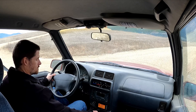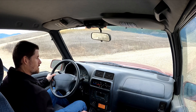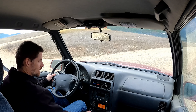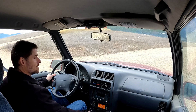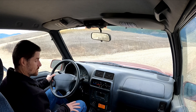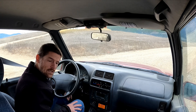One thing you'll find with this HyPer 9 system is that on a downhill, regen will never completely stop you — it will just bring you to a very very low speed, because it seems to be proportional to speed at low speeds. This adjustable knob is what I normally use because there are so many different grades around here and I need the ability to adjust the rate at which I'm slowing down. Hopefully that was interesting and gave you some more information about how that's set up. Let me know in the comments if you have questions — thanks for watching.